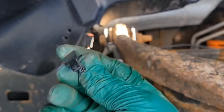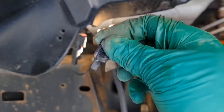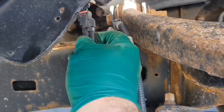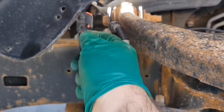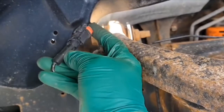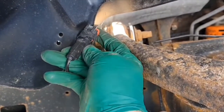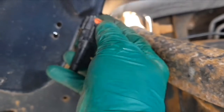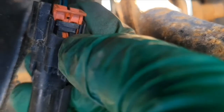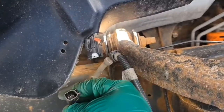This is what's holding that connection in the back here. It's put like this with the lock towards the bottom, into those holes. Now to release this plug, we have to move this little tab up. I find that it was easier to release by pushing it with the screwdriver at the bottom on the little red spot here, and after this is up, then you can press on this little black tab here, and then pull the plug apart.